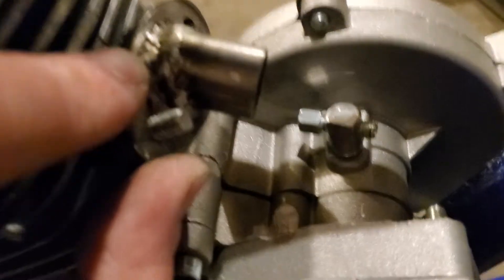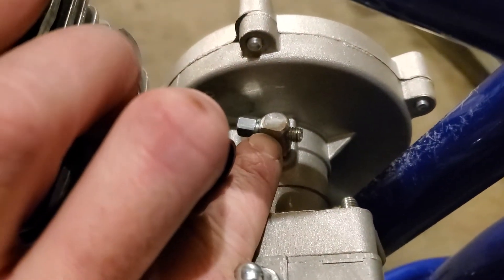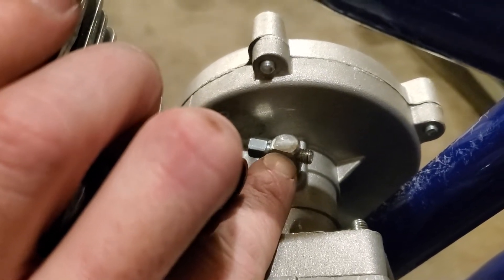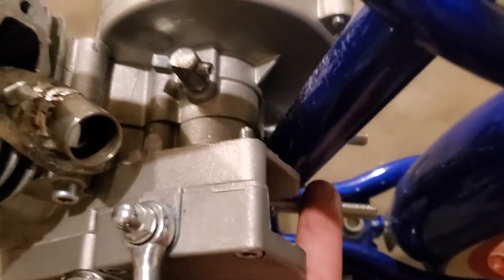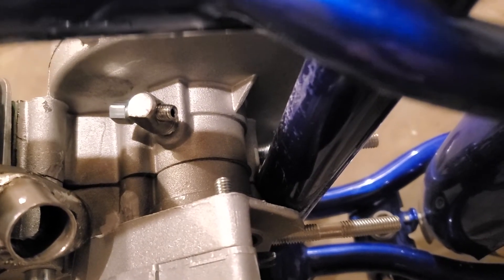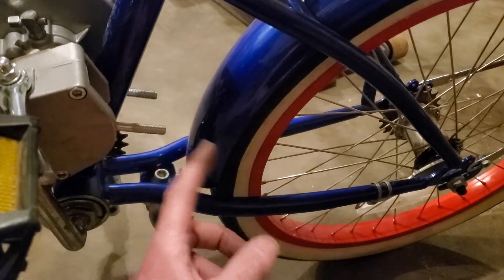When I do this I've got to make a little relief for the carb bowl, and also trim this off so the carb doesn't hit it. You don't have to run this back — that thing that slides on the tube — I just cut a little relief into this one. It's kind of a lot closer to the chain, which is good. The further you bring the engine back, the closer the chain, the shorter the chain — the better, at least in my mind.